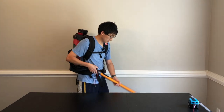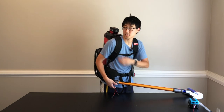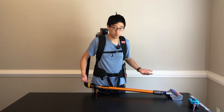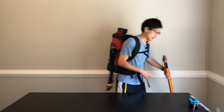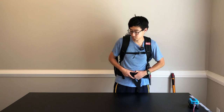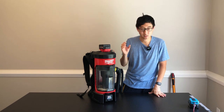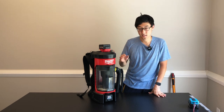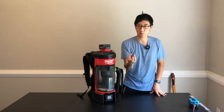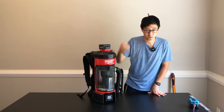I can vacuum like this for roughly around 31 minutes of runtime on just one 12 amp-hour battery. You could put a 2 amp-hour on this power source adapter here. It's pretty comfortable on your back — most of the weight's on your back, so the realized weight on your vacuuming arm is really light. The suction — meaning the cyclonic action on the Dyson — way surpasses the Milwaukee cyclonic action because this Milwaukee just has one big cyclone, whereas the Dyson has one big cyclone in the middle and a bunch of external smaller cyclones that really let the dust drop to the bottom.